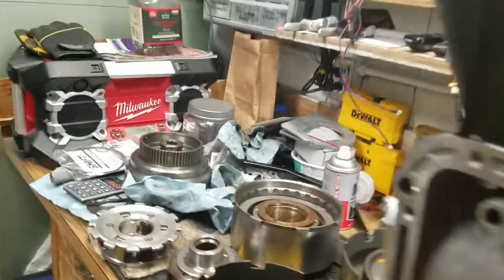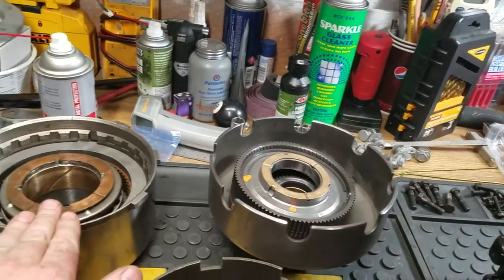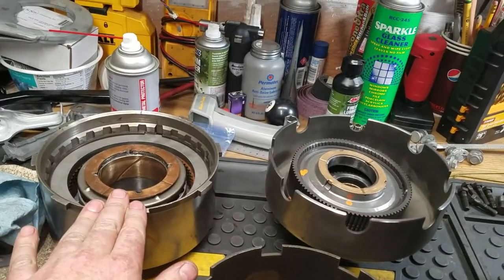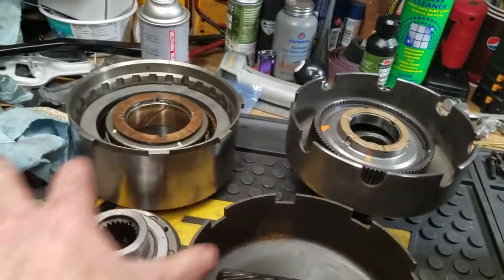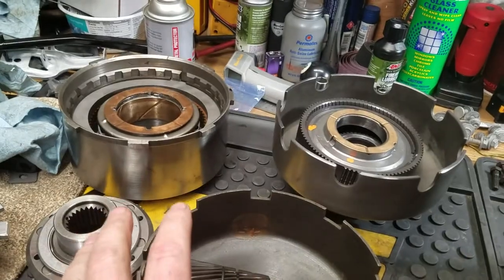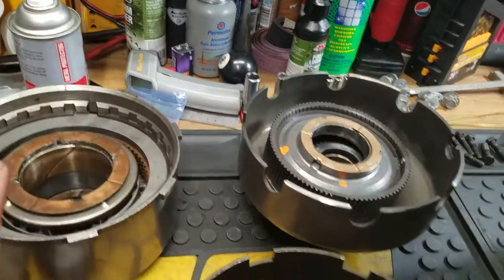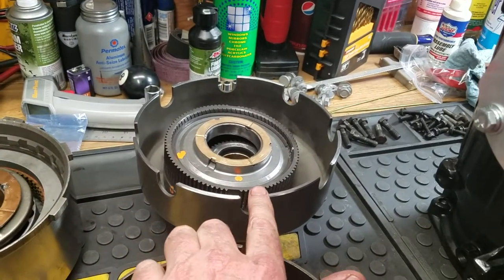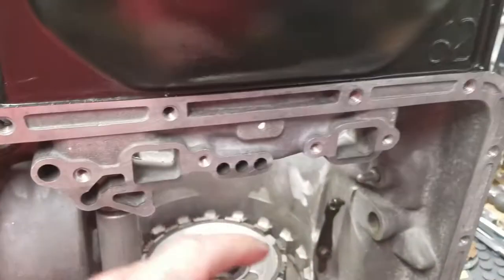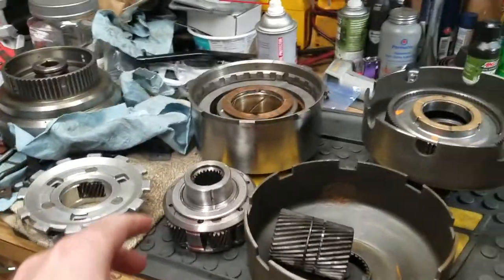But one of the cool things was that you could actually move the way this direct drum sits right in there, up and down, after I got all this other stuff together, because it's still splined into the clutches and everything like it's supposed to be, and it still splines in here. And it closes up my clearance on that stator support selective over there. So how I did that